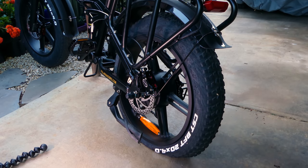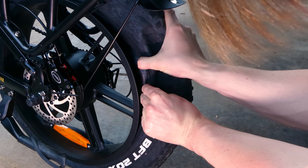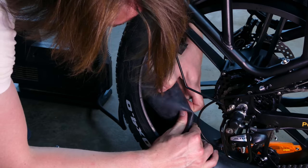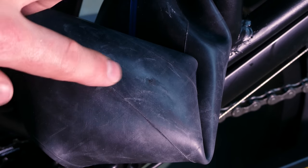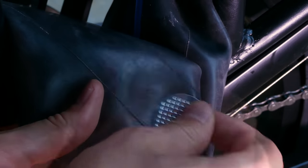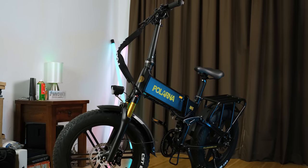Back on a sealed path though, I encountered a rather deflating problem. Since this bike is so big and heavy, a tyre puncture can be a real problem. I had a really big puncture to the rear tyre and I couldn't just wheel it along — I had to actually lift the back of it up because the tyre was flopping around a lot and was potentially going to damage the wheel guard or destroy the inner tube. Keep in mind you're going to want to have at least an air pump and a puncture repair kit with you. The inner tube took a bit of effort to partially remove from the rim, and it took some time to find the leak as the tyre had moved away from the original puncture spot. After carefully listening for the hiss, I eventually found the puncture — thankfully not torn and seemingly isolated to one small area. I roughened the surface, applied glue, and once it had set applied the patch, holding it on for several minutes. The bike was now operational once again. I still can't believe that puncture didn't occur during the off-road testing but on a paved footpath, so I'd definitely suggest having a little air pump, a puncture repair kit, and the small toolkit provided with the bike.